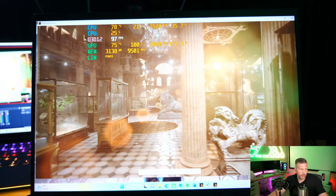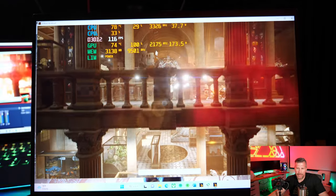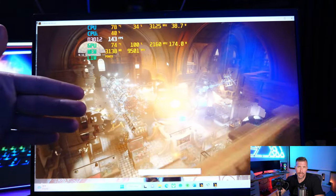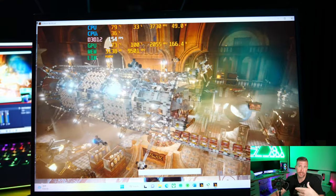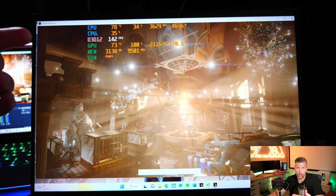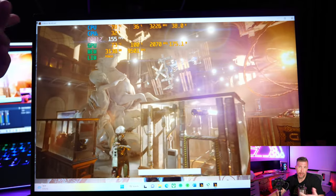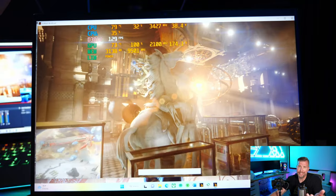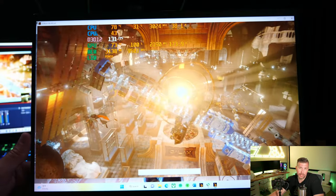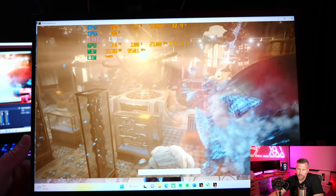So it's important to be moderate with what overclocks you apply, and to slowly, gradually increase them. If it is stable in a tool like Time Spy, then go into some really demanding games and make sure that they work in the real world. And if you use your NVIDIA GPU for video workloads, like Premiere or DaVinci Resolve, also test rendering in DaVinci Resolve and Premiere. It may improve your performance in those applications as well, but your overclock might also cause instability. So you'll want to do a full test of everything that you do on your laptop to ensure stability.